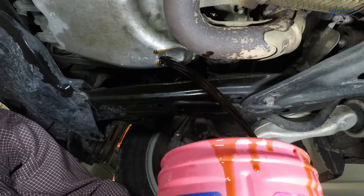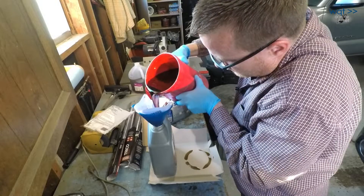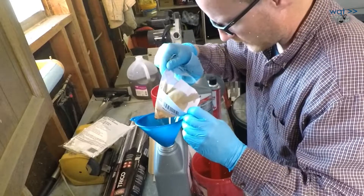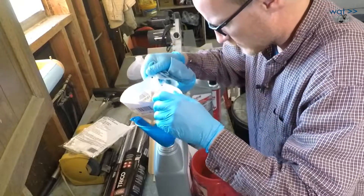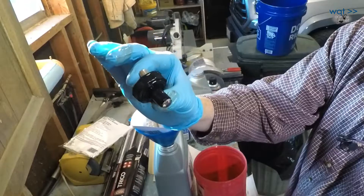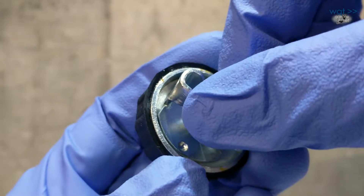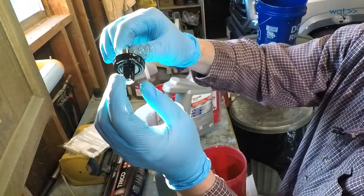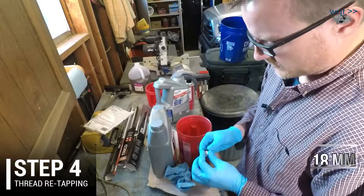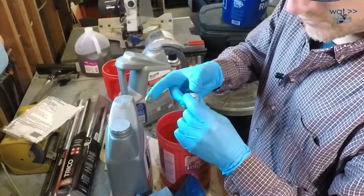It's going to be a little fidgety because the can is overfilled, but let's go. So far the only thing I'm seeing in the filter is a piece of plastic that fell in — it's round and circular so it didn't come from the oil pan. I'll save this filtered oil to use as wash oil after we finish tapping the thread. The expansion plug works by turning the top piece, which compresses the rubber up into the plug and expands it to hold the hole. Now, for cutting, we need the hole well-lubricated — plenty of oil on the bolt for cutting. No need for the washer while cutting. The package says 18mm for the wrench.